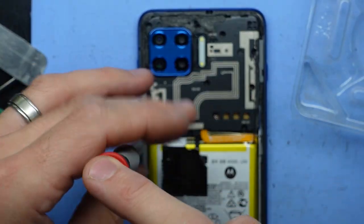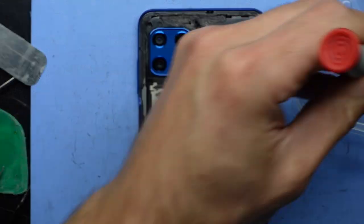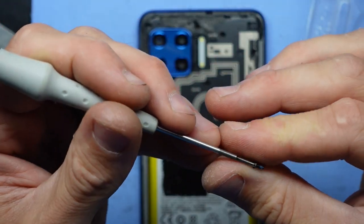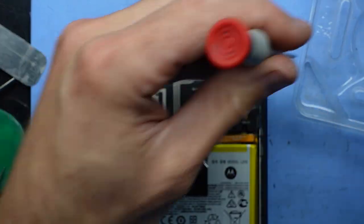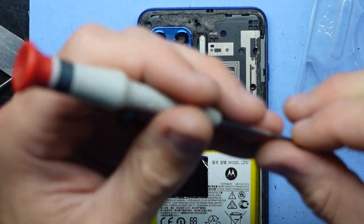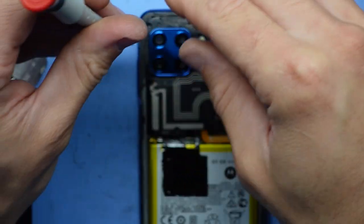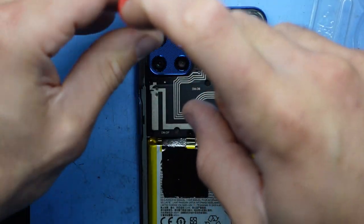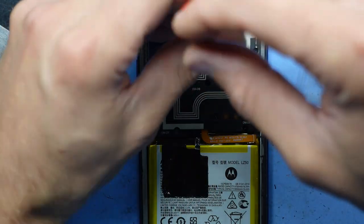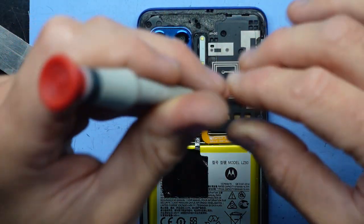As I said when we first took these screws out, all the screws are of the same length — there's really no need to be worried about where you're putting them. Right now as I'm doing this, my heat pad is still on at 75 degrees, so it is curing the adhesive on the front — that's the weight of the phone and how I pushed it down. Typically I'd want to leave that adhesive for usually 20 minutes or so with pressure on it. Usually when customers come to get it I have rubber bands still around the phone, and I usually say to leave it till tomorrow before they take the rubber bands off.